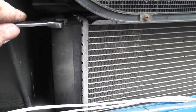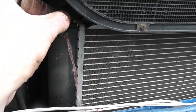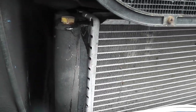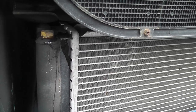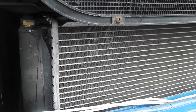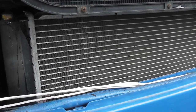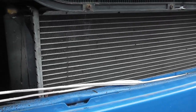It's a 14mm spanner you need. The reason coolant came out of there is simply because of the fact that there was pressure on the other end. As I said, you don't need much pressure, you only need a little bit. What we've done is forced any air up to the top of the radiator, and that's basically the job done.